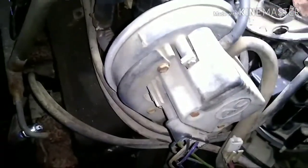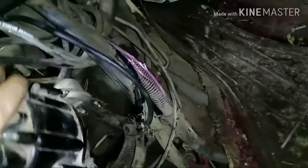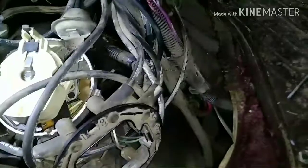Go ahead and get this cap off. Loose like I thought it did. I can't get the screwdriver on it now. I want to say I can't, but I can. There's always a way. Just go ahead and pull this off. I'm going to get the cap off. There we go. Let's go ahead and clean that rotor button up too, just for giggles. Have to, we'll change the distributor if all this in here is bad.